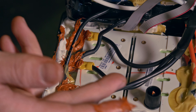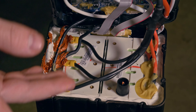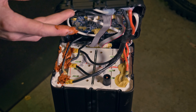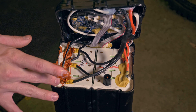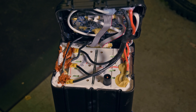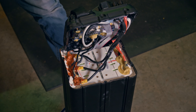Clean up around the rim where the gasket seats — we peeled it off and stuck it back on the upper half to make installation easier, so clean that seating surface so it makes a good seal. Then take the battery inside somewhere above 70°F and let it sit flat while the RTV cures. This particular silicone won't get hard like the factory putty — it'll remain a little pliable — but follow the instructions on the back for cure time. We'll come back to reassemble when it's dry.